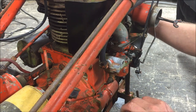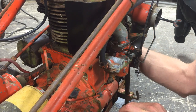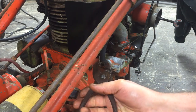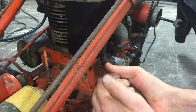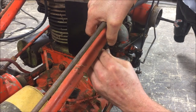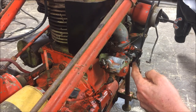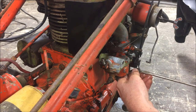I turned the fuel — actually no, I have not. We're going to turn the fuel off on the bottom of the tank. We'll get a little bit of fuel coming out of the hose — no big deal. Take this clamp off, just get it up out of the way. I probably need to replace this hose; rubber breaks down after 50 years. A little bit of fuel spillage, no big deal. I need to take off the choke cable.